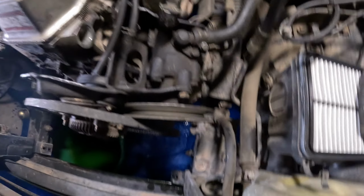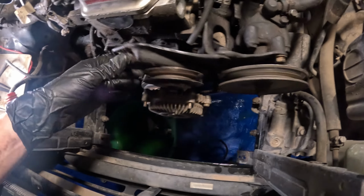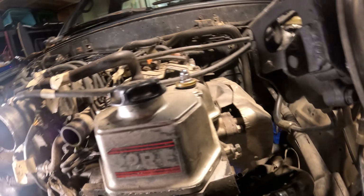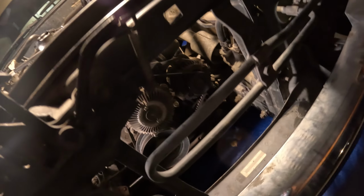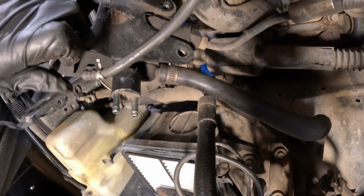So here is the power steering pump and bracket free. I unnecessarily removed this bolt. The other ones were all necessary, I guess. One right here by my thumb, one down here underneath that was accessible through the front of where the radiator used to be, then three on the back here, and two over here.